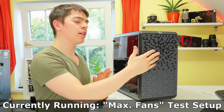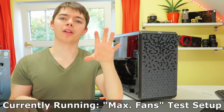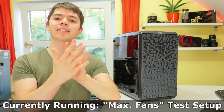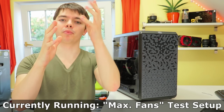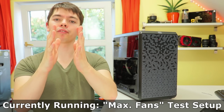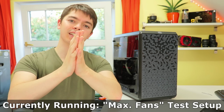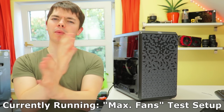Now, because the fans are intakes, generally fans on intake will have the frame behind the blades, and then the blades will be pushing air through past the frame. So you have the blades here and the frame with the spokes holding the fan, so that when it blows, it comes away from the frame and then hovers rather than pressing into the frame, as if the fan was the other way around, pushing. You know what I mean? The frame the other way around.